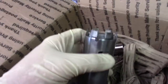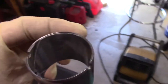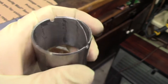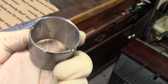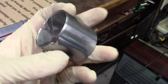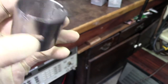Let's see how loose it is on the old yoke and the new yoke versus the new bushing. Yeah, this bushing is substantially worn. Let me see if we can get it in the light. Look at that. Look at how worn. I don't think that they replaced it when they rebuilt the trans. You can see that's the side that it was riding on, because there's a thrust side, and obviously that's where it was riding. That's where it wore it out. Now, I think that this was on the bottom notch, so that must be the thrust side. So anyways, yeah, this sucker is shot.